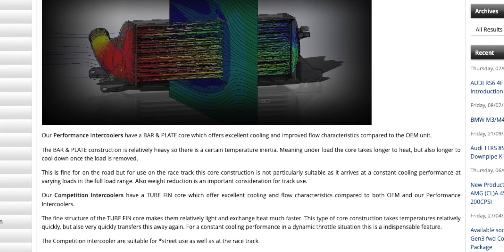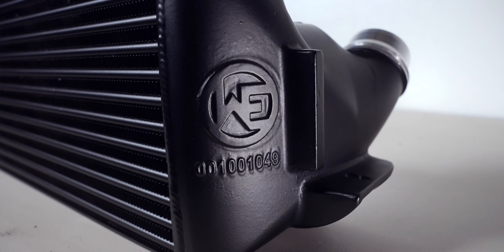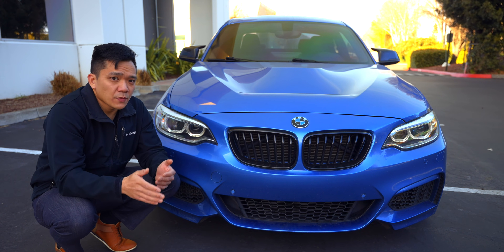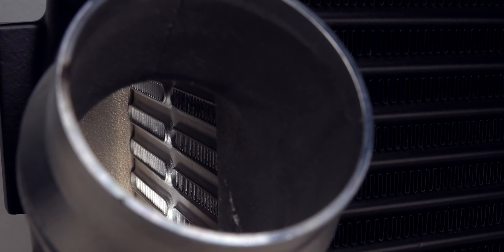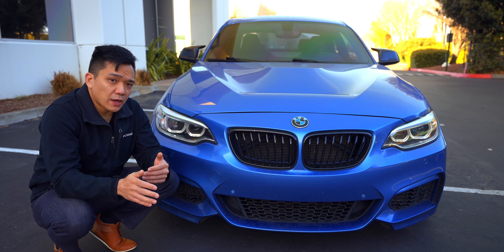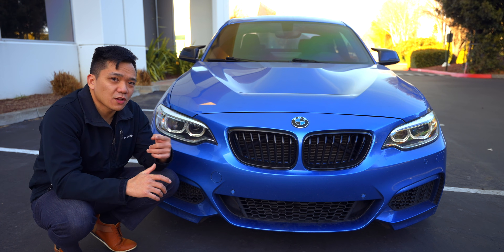You can also jump on the company's website to see if they have any other defining features to help separate between the two different types of intercoolers. If you have a serial number displayed on the listing, you could also call the company and see if they could run the serial number and give you additional information. Once you actually have the intercooler in hand, take a look inside — with a stepped intercooler, you should see two different sets of fins completely separated from one another, and then you know for sure that you have a tube and fin intercooler. If it looks like one entire segment welded together, that's your bar and plate intercooler. Please leave any questions down in the comment section below, check the description links for resources, and don't forget to leave a like and subscribe so you don't miss out on future videos.